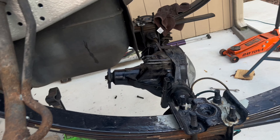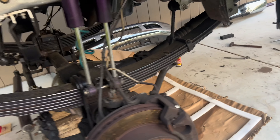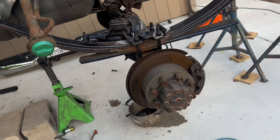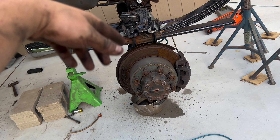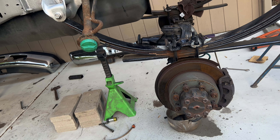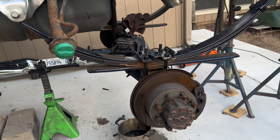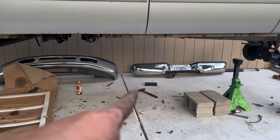I didn't do the time lapse because my gimbal started acting up and wouldn't work right, so hopefully I'll get a time lapse on the front when I get it fixed. This axle is ready to be dropped — the jack stands are going to go up underneath to hold it in place, run the U-bolts out, and then slowly drop the axle to the ground with a jack, putting something over the pinion to keep it from rolling.